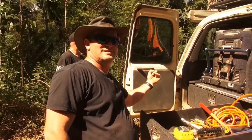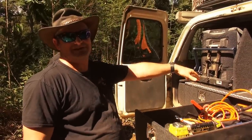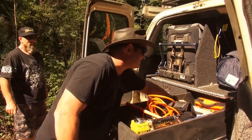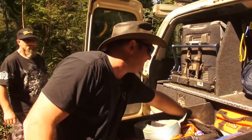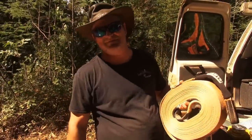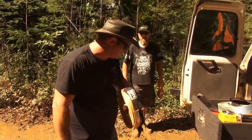Slide his car and hopefully pull him sideways, if that makes sense, back over the hump that's underneath the water. Why couldn't you just snatch him backwards? Because he's bottomed out in the middle on the belly of his car, and I think we'll just keep sliding over because that middle trench is soft as all buggery.